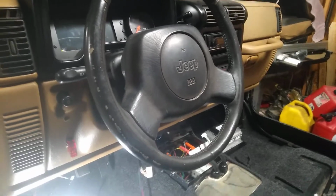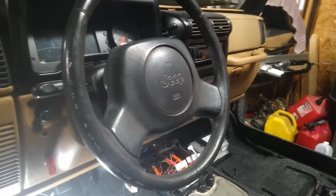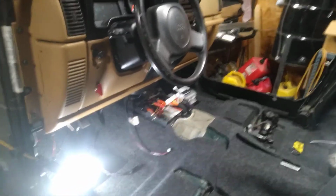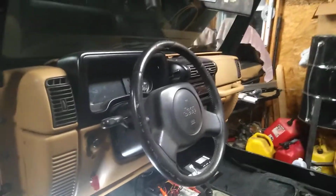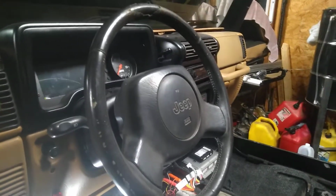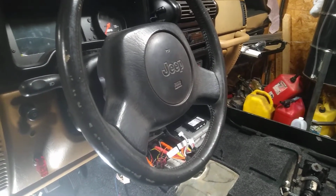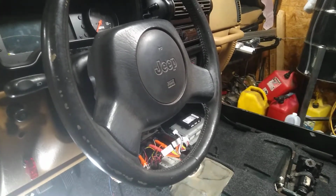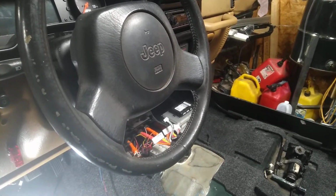And what I mean by all the time is, of course, whenever I start the vehicle and want to drive, that pump needs to come on, but I don't need it to come on whenever I plug in the J1772. So the Orion BMS sends a ground signal to activate something. I just have to figure out a way so that the drive unit pump is only on when the drive unit is on. Now the Orion doesn't know. Is that true? I don't know. I may be able to go into the Orion and use one of its multi-purpose outputs to give me a ground only when the vehicle is on. I don't know. I'm going to have to check that out.